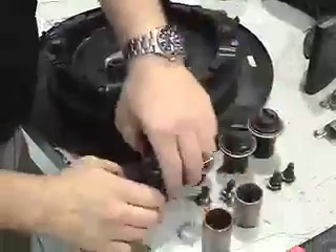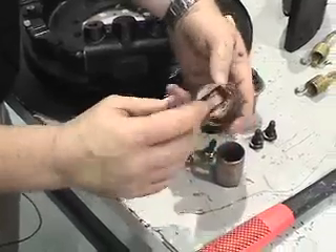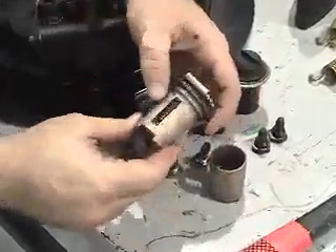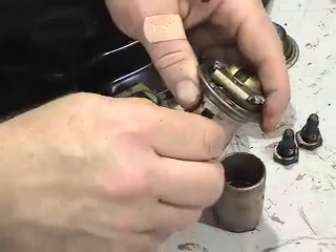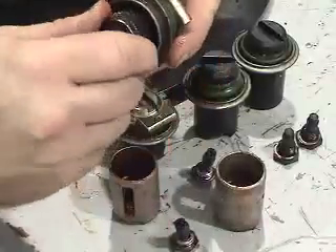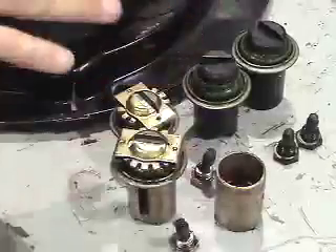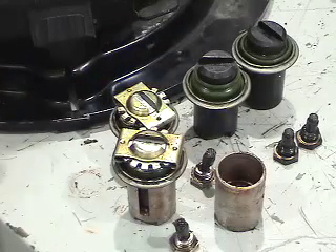You'll see on the adjusters, they fit into their own sleeves. Notice the taper on the plungers. And these guides or pawls fit in here. We want to make sure that these are well lubricated so that they're not going to seize up. That's one of the big problems with these brakes — people inspect them but they don't take them apart, lubricate, and clean them.